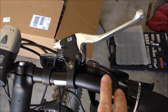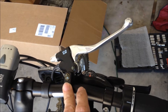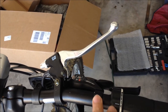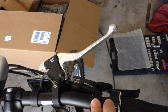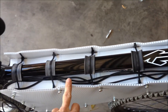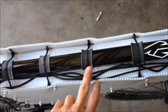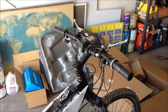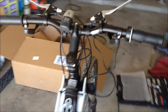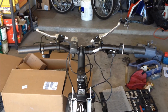I did have to slide the original shifter and brake lever off, put in the brake inhibit switch, then put the brake levers and shifters back on, and then the throttle on this end. I ran the wires along the channel on top of the Coroplast and I'm going to cover it with another piece of Coroplast later once I run all the wires through it. The position of the brake levers and shifters is somewhat different from stock, but it's a compromise that has to be done to get it to fit on a specific bike.